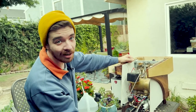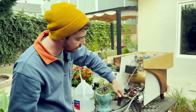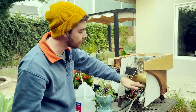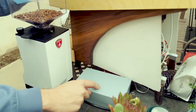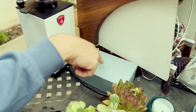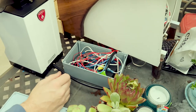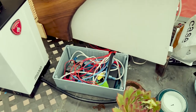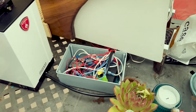Here are some of those same components from above. On the other side, when the water splits down here, this solenoid opens up and allows water to enter through these pipes and fill the boiler until it touches this probe we saw from above. The last thing I wanted to talk about is this electrical box right here — all of the electrical components get drawn in through here. Inside you can see a big nest of wires — it's basically an Arduino-based board with a transformer, some relays, and a solid state relay that controls all of the high voltage stuff. All the switches and everything feed into this right here. This is the box responsible for controlling the machine — kind of like the main board or CPU.